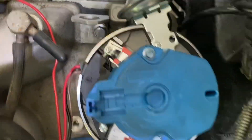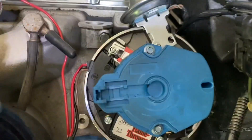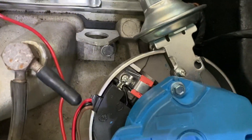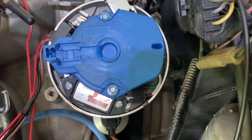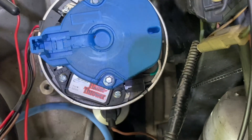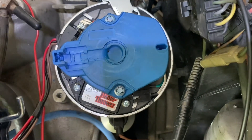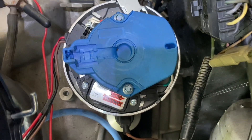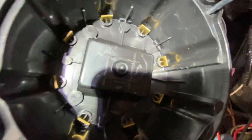Let's take a peek under the cap. Well, the good news is there's no oil in here — that's why we swapped the distributor out the last time. But the center of the rotor is missing. Where the hell did it go? I've got to pull the rotor off here and see if all the parts are underneath it. This is crazy. This stuff got a little chewed up in here but not bad — all the electrodes look okay.